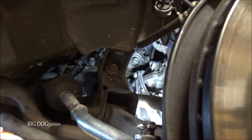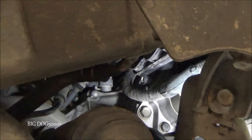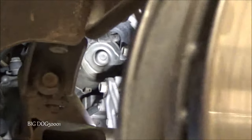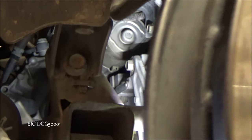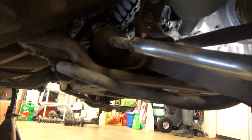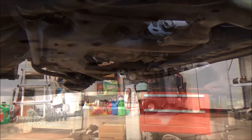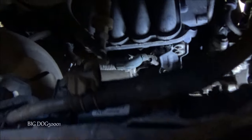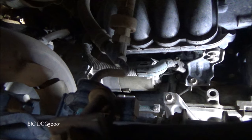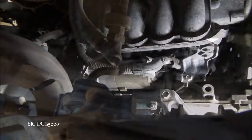From the passenger side, if we look right past the brake rotor, there's our starter right there — you can just see the end of it. And from the backside, you can see one of the bolts, so you can see how fun it is to get to. Some people pull the axle out and go in through the side, but we're going to do it how Honda recommends and go from underneath. Looking from underneath the car, there's another shot of the starter right in the middle — tight area, hard to get to.